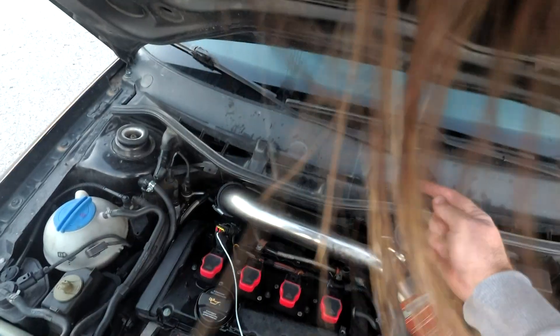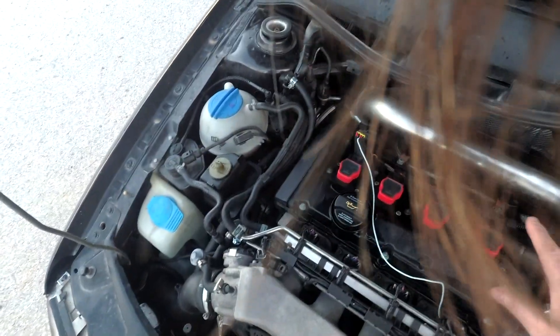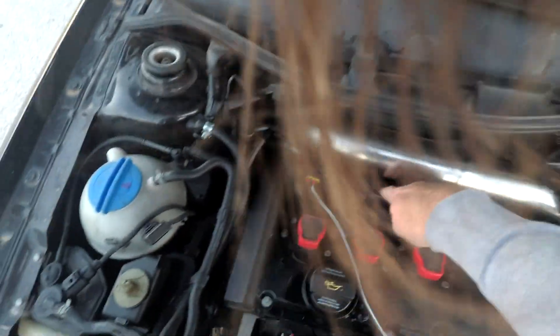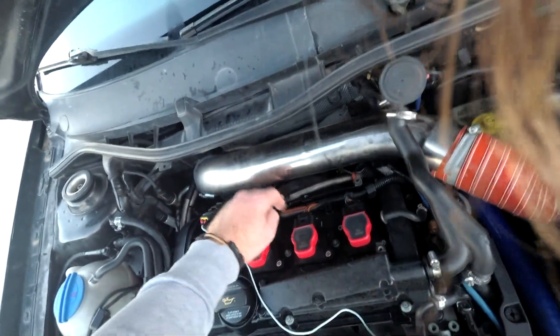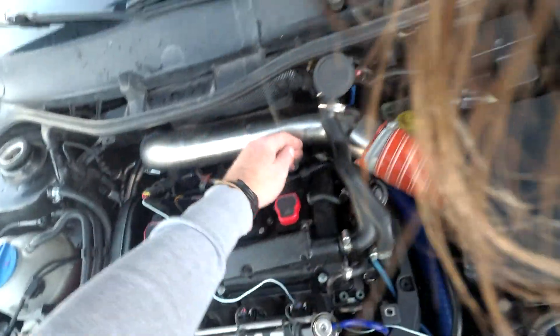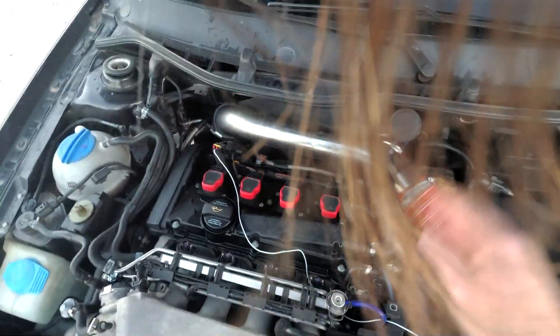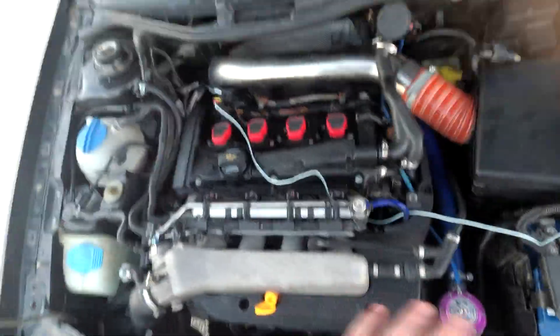If it's going outside the car or exposed to road debris, fair enough. But inside the engine bay, you've got to be very careful that these things are not rubbing on anything. Luckily, this side only goes to here. You can see what I've done — I've put some plastic cable sleeving over it. And this seems to be holding up fine. I've just sleeved it over the entire length of this hose, so it's no longer in contact with any of the cables, plastic fittings or anything like that. I would say that will probably be good forever, touch wood.